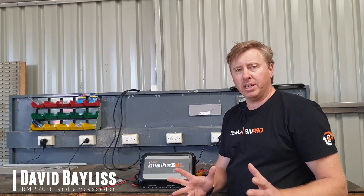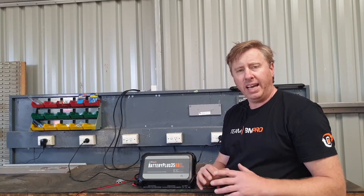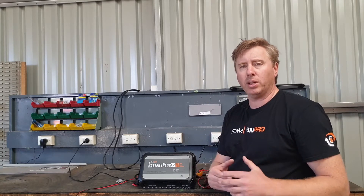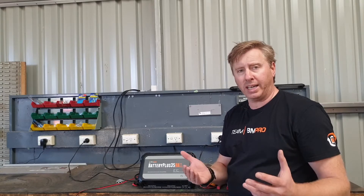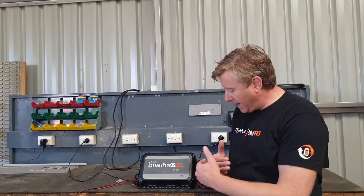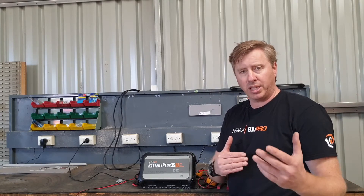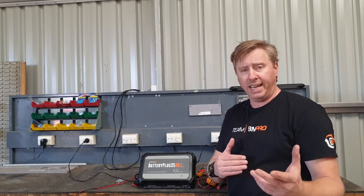The next tech tip is about wiring and fuse locations. On this unit, the fuses on the output side are all resettable electronic automotive fuses — the sort you'd expect to find in your car. If a particular output exceeds its amperage, going over 10 or 15 amps depending on specification, it will go into fault and shut down.